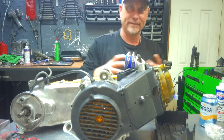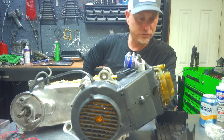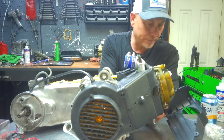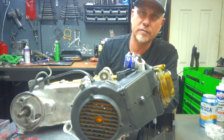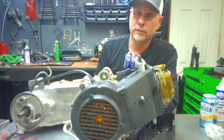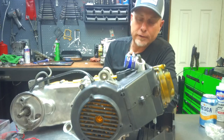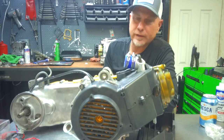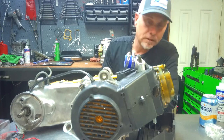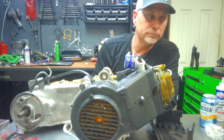What could the problems be with that? Overheating, pre-ignition, bad piston wear, rings — because when things get hot they overly expand, get tight, and cause more friction and more heat. These shrouds are important, and they really aren't that expensive. I sell them separately here — they're $4.99 a pop, so for 15 bucks it's the cheapest cooling system you'll ever find for any machine. But they are vital to how these run. Not having these shrouds on can make your motor not last very long.